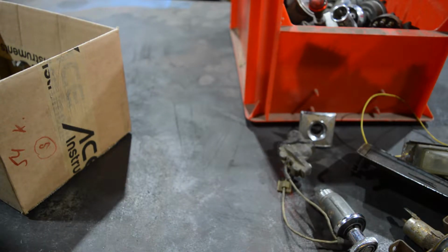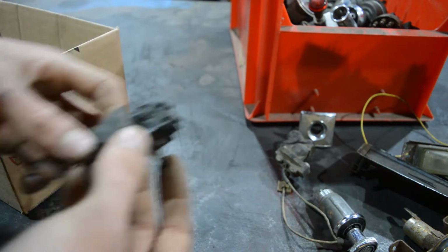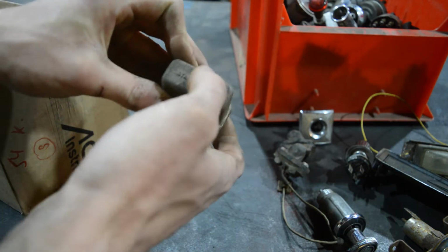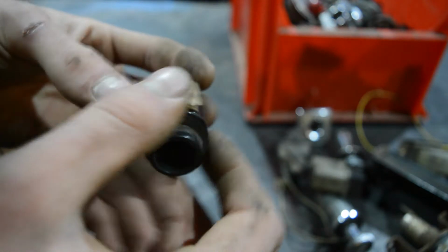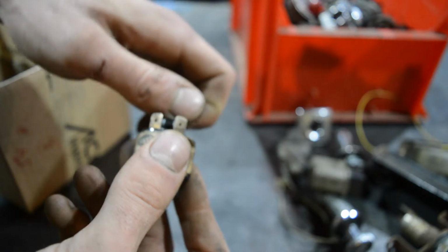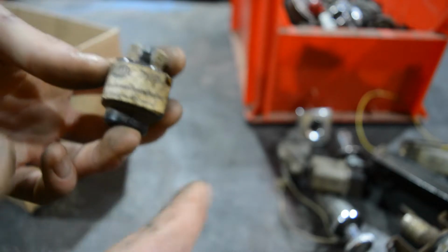Then what we need, spoiler for later, very much later actually, there are going to be a couple of videos before I use it. We have this little piece here. If you know what this is, you know what I'm going to build in the future. This should be out of a Corvette. This actually allows you to start the car with the touch of a button. I really like that, and I wanted this. This part goes on the back side of your speedometer, and you screw it in. You basically sandwich it between your speedometer and the cable itself. I think one revolution here is going to bridge both contacts. So this was used to track your speed at all times. But maybe if I can come up with something clever, we can use that to give this car a modern flair.